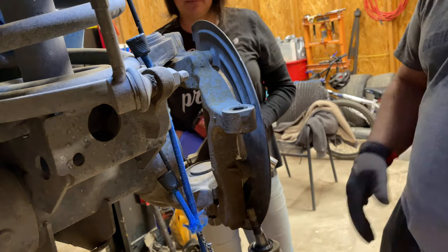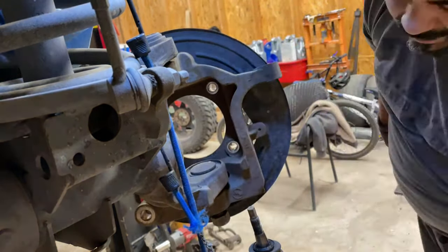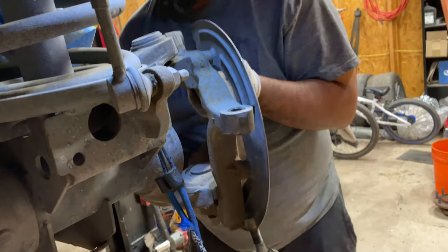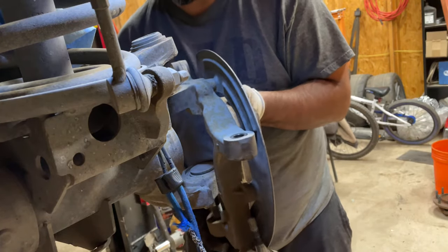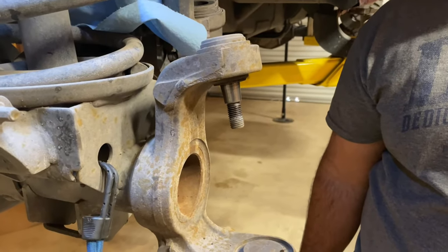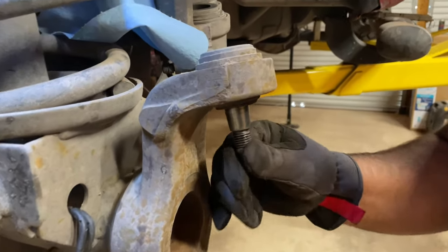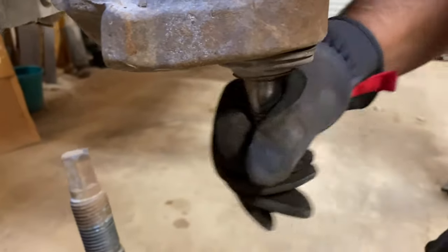This knuckle off the ball joints. Back up, take off the nut. That nut was to hold it from falling off. And now you got the thing loose. So that movement we had earlier of the tire, when I checked it, it made a clunky noise. And here's your clunk. Yeah, it moves. It articulates.